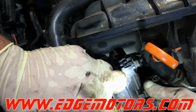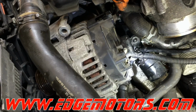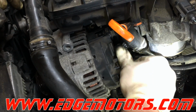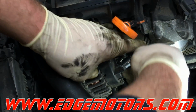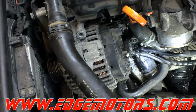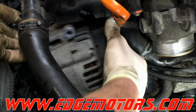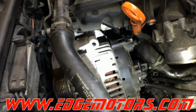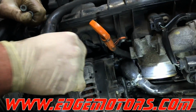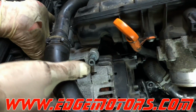Connect the driver right away. The power lead. Put the power wire cap back on. Align the alternator to the 4 holes. It's easier to slide the bolts into the alternator first. The top bolts and the bottom bolts go in no problem.